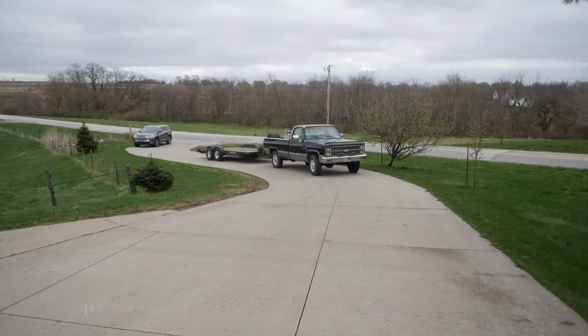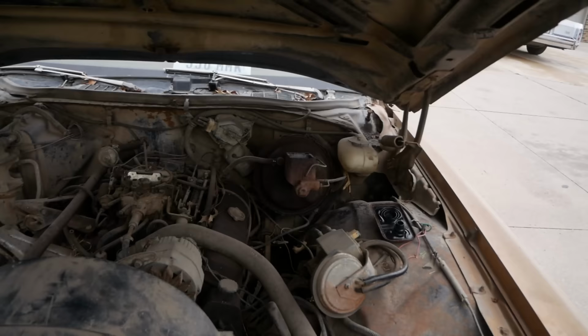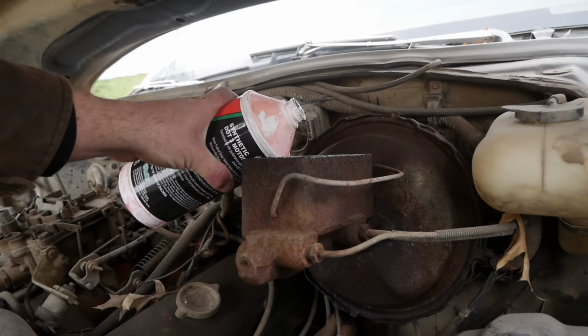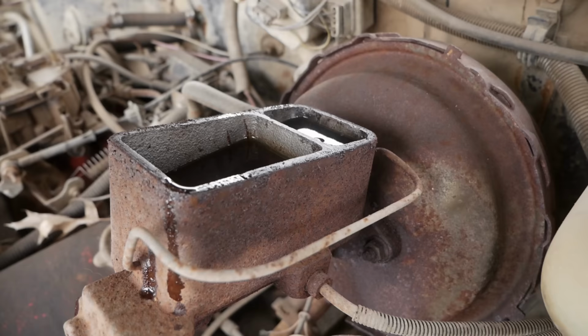We did bring a trailer, just in case. I think we really should start with brakes on this one, actually, because of the hill we're working on here. If we can get any brakes at all, it'd sure make loading it easier, worst case scenario. Let's just fill her up, and then go slowly depress the pedal a few times, and see if we get some bubbles. '76, of course, will come with standard disc brakes on the front of all GM cars.